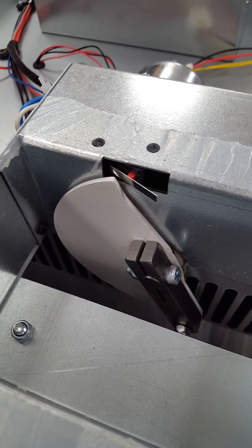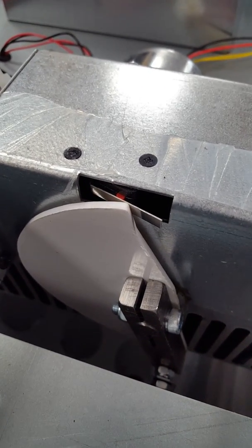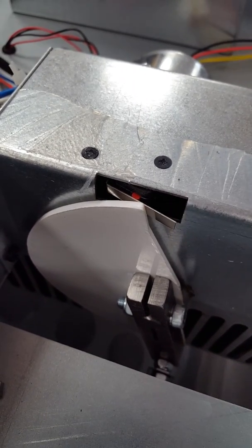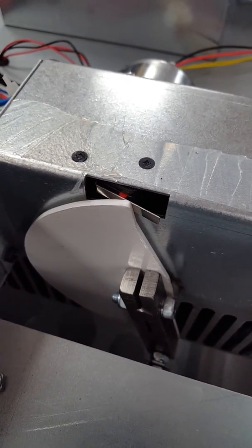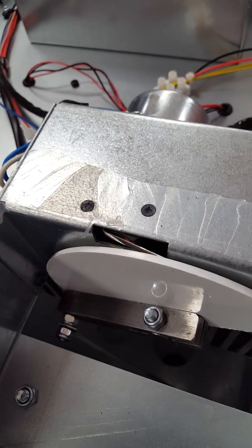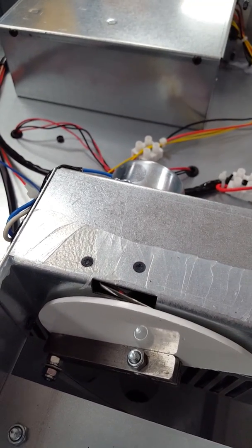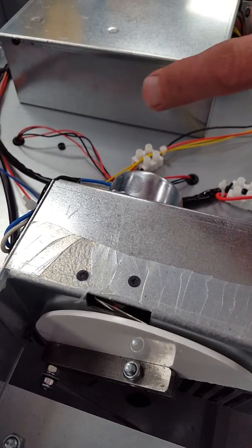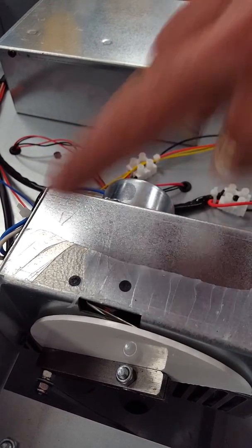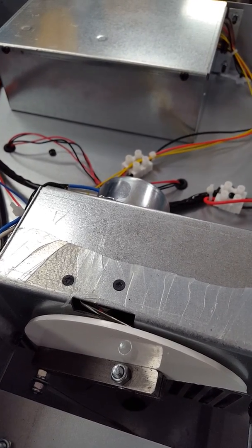So this is a normal working switch — there's no strain on that switch at all. And that's stopped. Basically, what happens is if the machine's worn or gets damp, condensation builds up and corrosion builds up on the internal contacts of the switch. And because it's very low voltage — about one volt, about one or two milliamps — there's not enough power for it to actually make a contact. So the control board can't sense when the switch is closing.